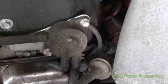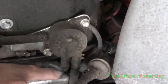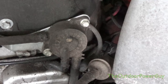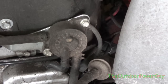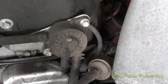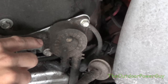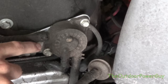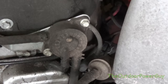This line right here is coming from the fuel tank — you can see it's got the fuel filter on it. There is a hookup right here on the bottom of the fuel pump; it's the port all the way in the back and that is your inlet from the gas tank. This line right here is your output to the carburetor, or outlet port, and that's going to be the one on this side of the fuel pump when you're looking at it from this way.